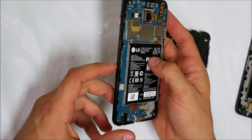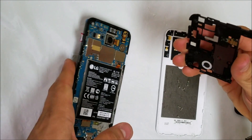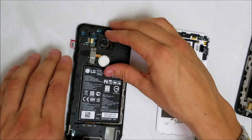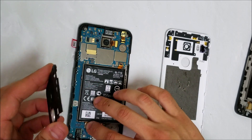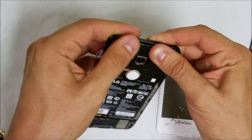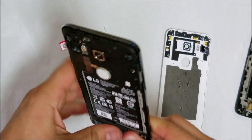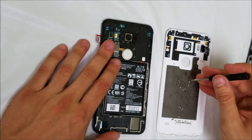Once these little parts are back in, we're ready to go ahead and place the back cover on. Make sure there are no screws on the magnetic speaker area. Make sure all the flex cables are connected. Give it pressure so that all the clips of the back housing clip back in. Once you feel they're clipped, go ahead and place all of the Phillips head screws back on.